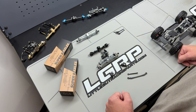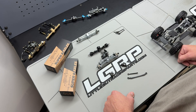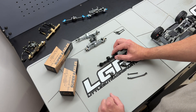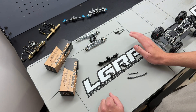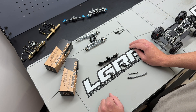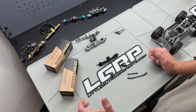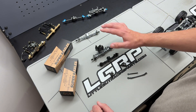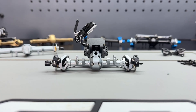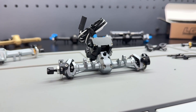One of the biggest controversies we see online about our Super 8 axles is going to be the adjustments we've made to the link and shock geometry. On our Super 8 V1 axles, we widened the surface that the shocks mount to, as well as where the links mount, compared to a stock Axial SCX24. What this does when you stretch the wheelbase of the car is it gives you back link geometry to keep proper triangulation numbers and keep the axle from moving side to side under the chassis. We have made some slight adjustments to the link and shock geometry on the new V2 axles — we have narrowed the link geometry by about 2 millimeters. The link mounts and shock mounts were brought in just shy of 2 millimeters.